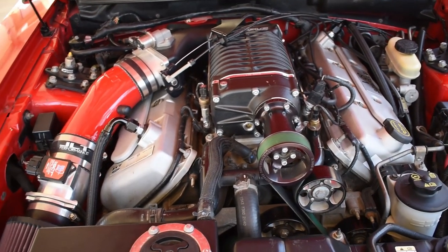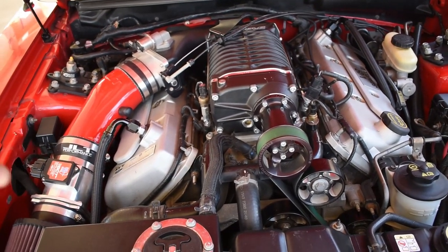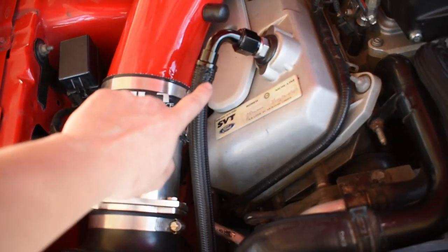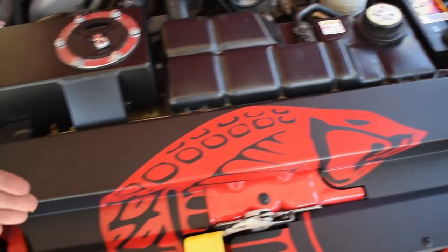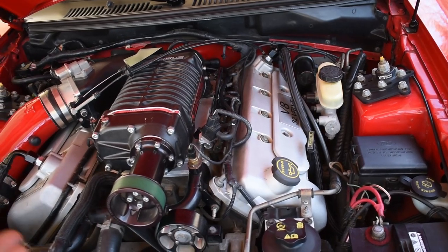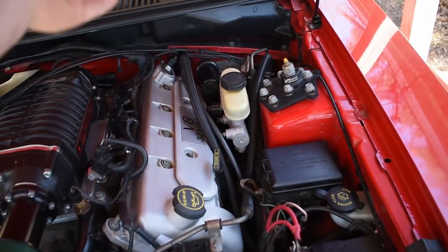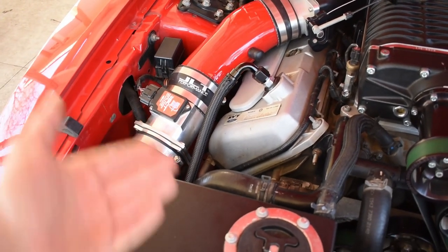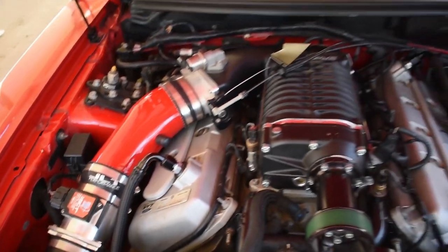For any of you who are interested in doing this exact same mod that I did, I'll put links in the description of all the parts that I ended up purchasing. And just to let you know, I ended up cutting 5.5 feet for the passenger side hose that I ran in front of the radiator. And as for the driver's side, I bought a 10 foot piece of hose. So if you subtract 5.5 from the 10 foot hose, you've got 4.5 left. So a 4.5 foot hose for the driver's side and 5.5 for the passenger side. And I ended up using just 90 degree elbow AN fittings.